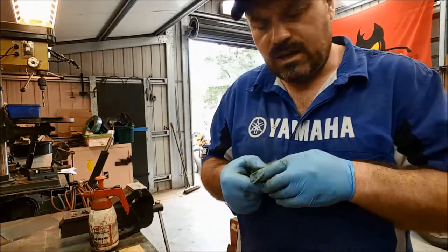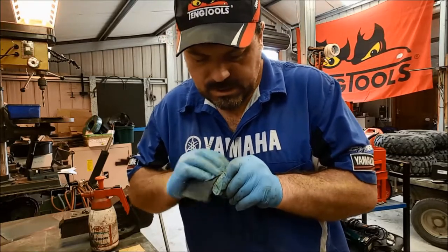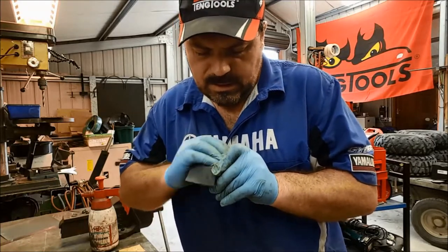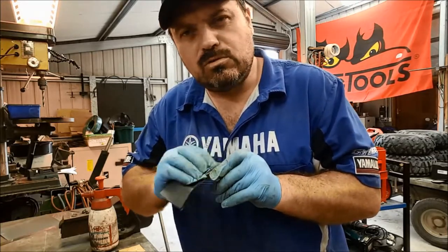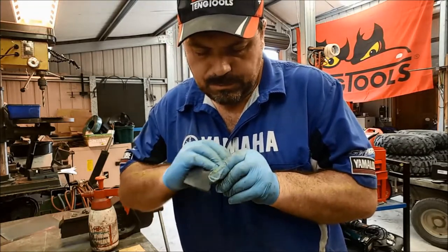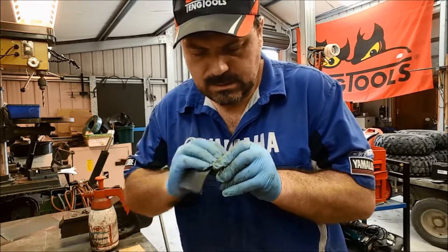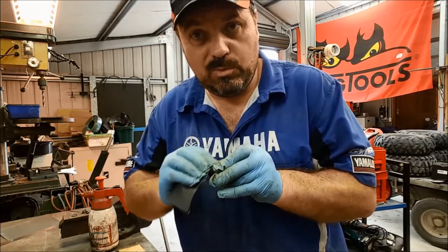Quite a few boat trailers these days, and the braking systems have gone on to, over in New Zealand we can have hydraulic brakes on our trailers. So a lot of the trailers that are used for launching boats, they've gone away from steel pistons and they're using almost like a ceramic kind of piston, which of course doesn't have any problems with corrosion, but they do still bind up in the caliper. They still get deposits building up on them, and that causes additional resistance. It causes them to stick on the seals and bind, and that causes the brakes to bind on or not operate at all if they're really bad.